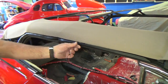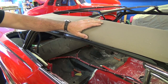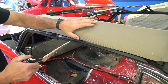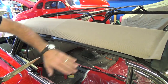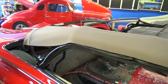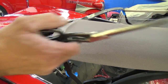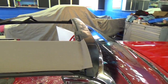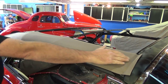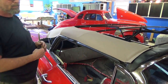At this point we trim that down to fit just right above this rail — you don't want it to overlap because when you make your convertible top, the top will overlap. This needs to stay just right behind this so the top barely pushes in and you get a nice clean edge. Now we're going to transfer this to the Stay Fast material. We'll staple it in right through here and on the top to hold it in place. When we do the final install it'll have screws here, staples there, and we'll show you that process when we put the pads on.